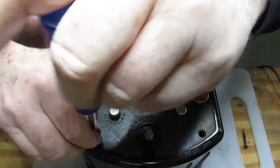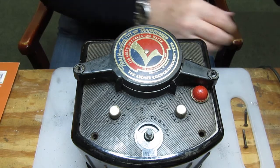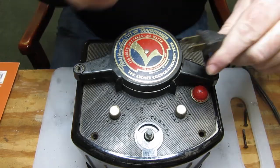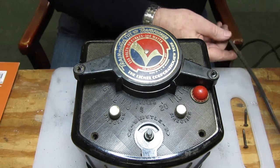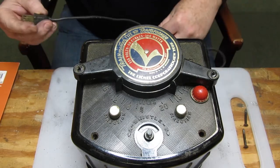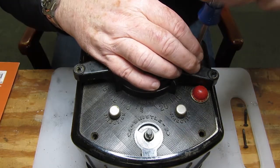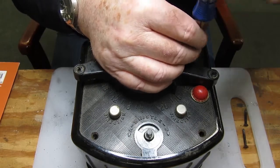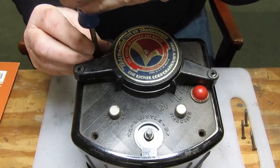These things have been in here a long time — this is the first time we're taking it out. Notice here that we've got the original Lionel cord on it. The cord is gummy and I tried to get a current on it, but I didn't get any reading with a voltmeter. So we're going to have to replace the cord. Always, always, always before you start working on anything, make sure that the cord is unplugged. And when in doubt, replace the cord.